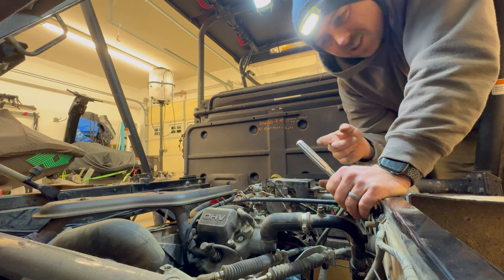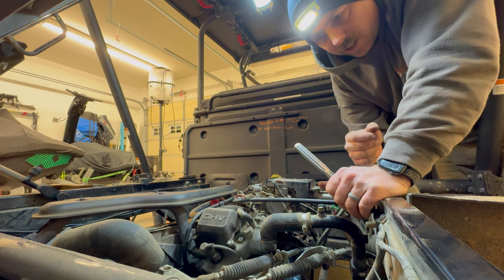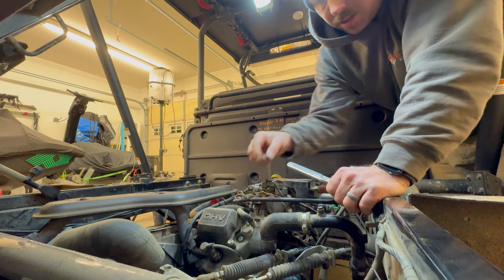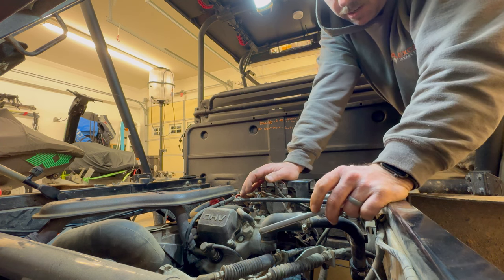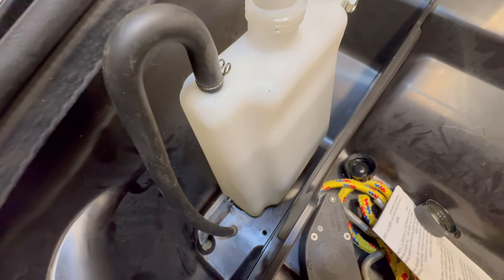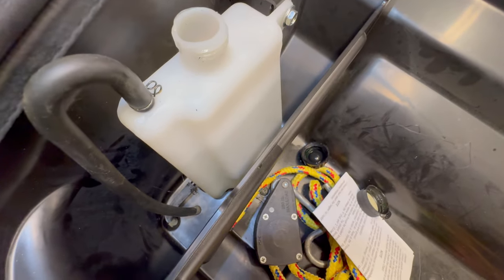By the way, I saw it's called a jiggle valve — that little metal piece that jiggles at the top, and it does go to the top of the thermostat, so we were correct. The housing's bolted back on, nice and snug. Basically all we need to do is reconnect this hose and start bleeding the air out. Make sure you keep this tank full — unfortunately I did not, and it drained below the tube, so I probably got more air in the system. I'm going to fill it up with coolant and then bleed it on an incline.